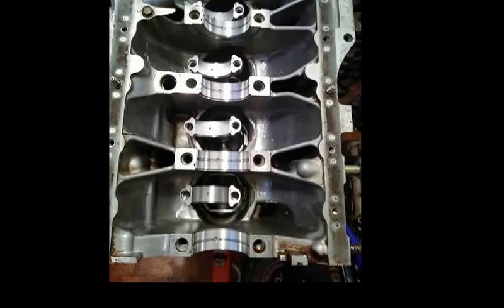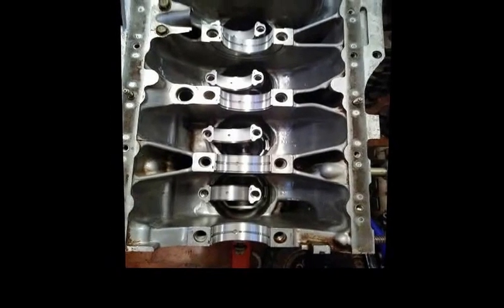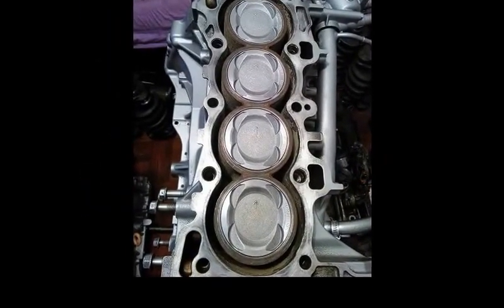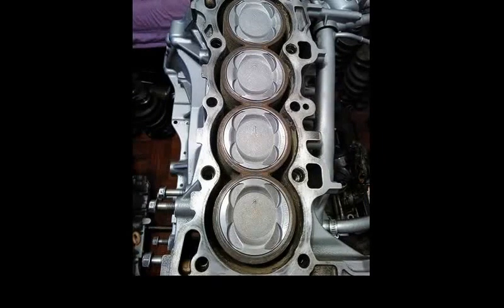And plus, I've got to think, overall, the cost of a single cam build compared to a B series is a fraction of the cost. You can buy a transmission for $50. You can buy a complete head, distributor, intake manifold, everything for like $100, compared to a DOHC VTEC head that you can get bare for $250 or complete for $500, and a B series transmission for $500 to $600. Everything is just way cheaper for the single cam, and it made the exact same power a B series would have made at the exact same pounds of pressure from that kind of turbo.